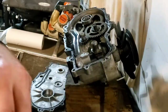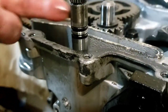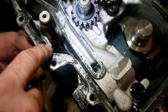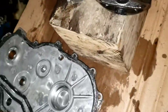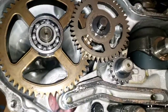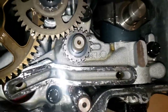This is the parking brake. See these o-rings — there's two o-rings right here, and there's also ones on the other end, and that's what's leaking. Can you see down that shaft right there? There's no ring — my fingers can't get in there. So this whole part of the hydraulic chamber has to come out. The filter is right here — it goes right here, see my hands, then it goes up through here, down into there, cleans it. So dirty oil goes up and around, filters through, and then after it filters it goes back through everything.